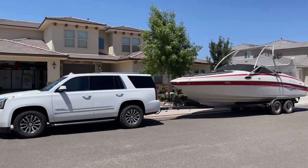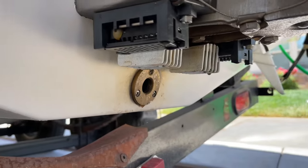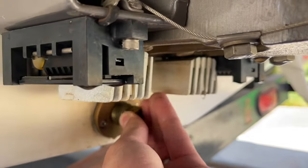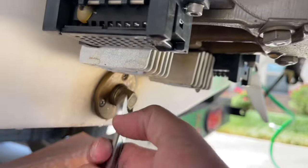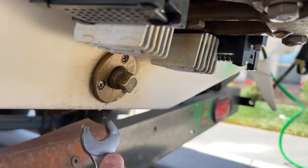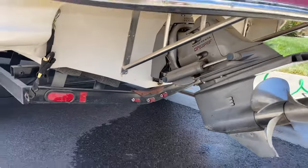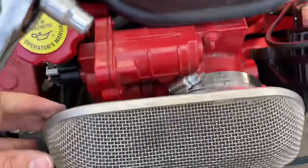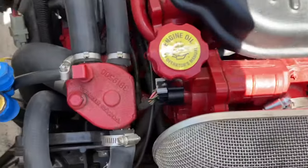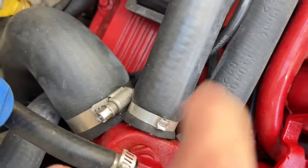Make sure that in the whole process you put your drain plug in before you drop the boat into the lake, and do everything else you're supposed to be doing. We'll be making more videos on how to launch a boat, how to remove the straps, and those kinds of things, but make sure as part of your check that you have the drain plug and the tool to tighten it. That's the last thing you want to do is sink your boat as soon as you get to the lake. Make sure that the trim is up so you're not dragging the prop or the drive, and look around every hose you can find and make sure everything is tight. They take off a lot of coolant hoses when they add the antifreeze, so anywhere you can find a hose, make sure it's tight and has been replaced properly.